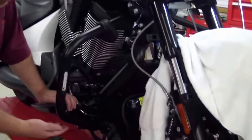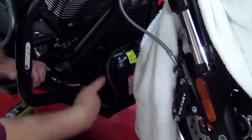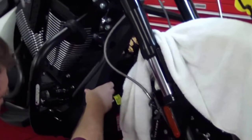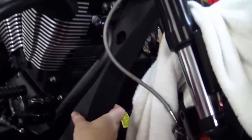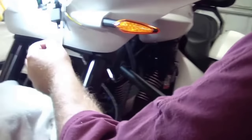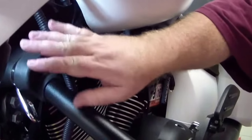I've got all the wires from here — a black and white wire coming out from each light through the bar — and I have them through some protective wire loom. I took the side panel off to get access. It doesn't look very pretty here, but once you put the side covers back on you won't notice it. The side panel and front cowling will cover that up. On the other side, I've run a black and white wire down that I'm going to connect into the wiring connections I did for my horn previously.